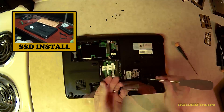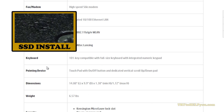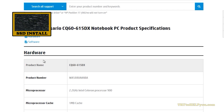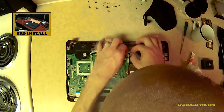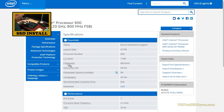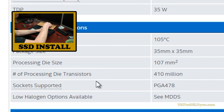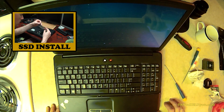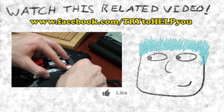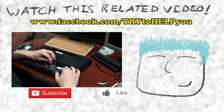Here's another video if you want to see that — you can click here. You want to probably stop by the manufacturer's website and get some information on your laptop before you start this. It's possible that the CPU is hard-soldered onto your motherboard, in which case you will not be able to upgrade. If you go to the manufacturer's website, look for something like the CPU socket type. If it's nine bucks like it was for me, it's pretty simple — this is an old laptop and you're trying to refresh it, and boom, it worked out great. If you like this video, there's a button for that. If you want to see more videos, there's a button for that too. Anyway, see you later, Internet — I hope that helped.